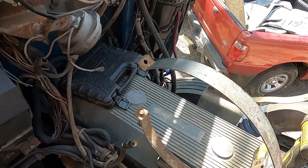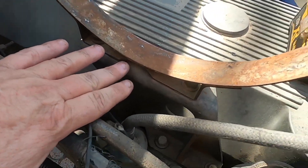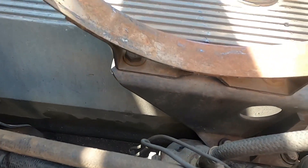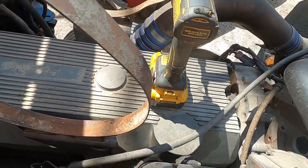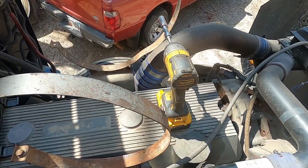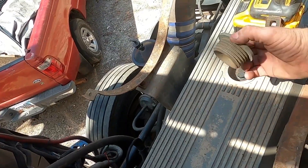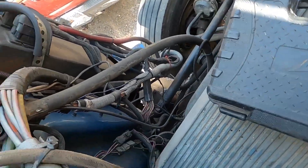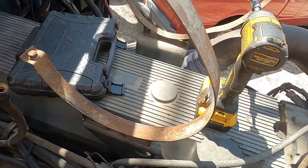I've got the air cleaner housing and all the ductwork off. I still need to take this bracket off — the valve cover will come up over the other one, but this one is angled over the edge of it so I have to take it off, which is no big deal, just two bolts. These 60-series valve covers are not bolted down a whole lot — they're fairly easy. There's one bolt there, and this one still has the original covers. You pull these out, there's a bolt there, pull this one up, there's a bolt there.